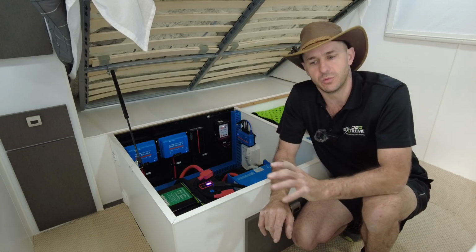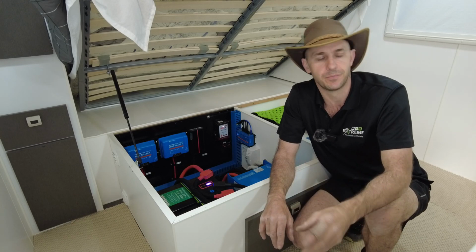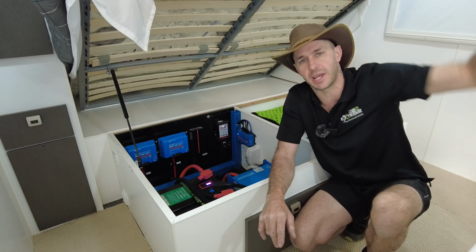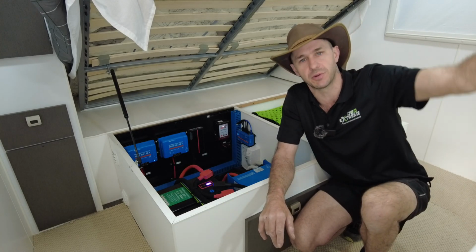With the solar on this, as we pulled the panels up and realized our 150s, we swapped them out for 200s. So in the same spot, but moved over slightly, we've got now 600 watts in the same footprint as they had 450. We've also replaced the air conditioning on this. This had the Ibis 3 roof clunker.